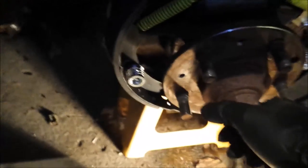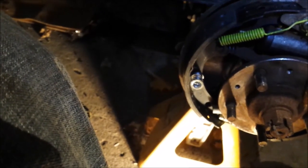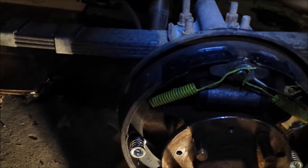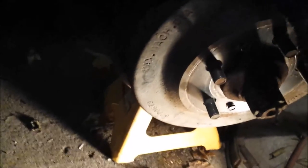There we got it. Aside from a little axle play, this thing should be good to drive for a while longer. What I'm going to do now is just cycle the e-brake a couple of times. Then we're going to adjust the star adjuster — what you want to do is adjust it just enough where you can feel a slight rub. Then bleed the brakes out. There you got it guys — all back together. Just a touch of drag on there.